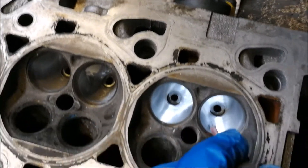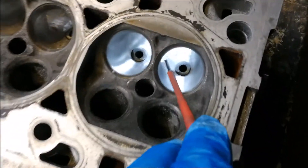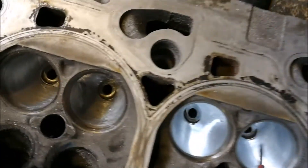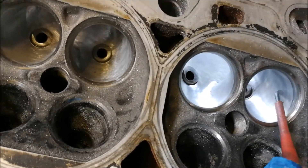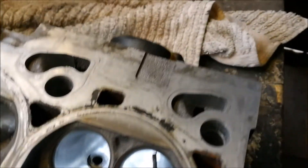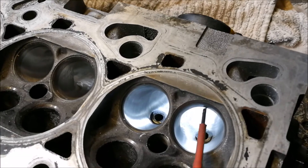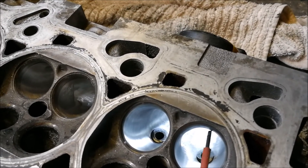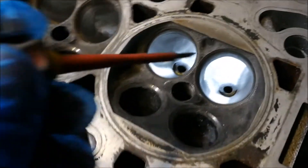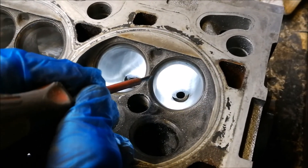You can see I've smoothed out the bowls to an 80 grit finish. Opening up the bowl slightly on the inside — one of the big restrictions was the area of the divider here, so I've opened that up, also the sides. The floor comes in here and that's just had a very light sand. I'm grinding none of that — I'm not keen on changing the shape, because I do not want to ruin the airflow at the floor.